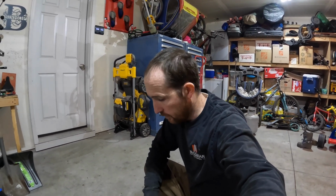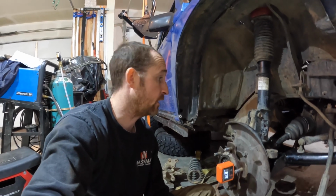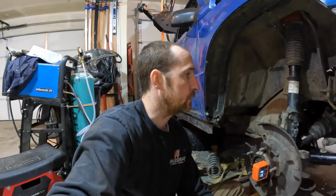Yeah, there's a little bit of difference there, so something to point out. Thought it'd be important. So yeah, got the lower control arm in it. I'm putting the diff drop bracket in it, and then we'll be right back to show you. We'll start measuring. Okay, we're back. I got the aftermarket control arm put in there. It was a pig to get in there, mostly because my tracker's been bounced off a few rocks. Things are not exactly straight. Anyway, let's look at our angles now.